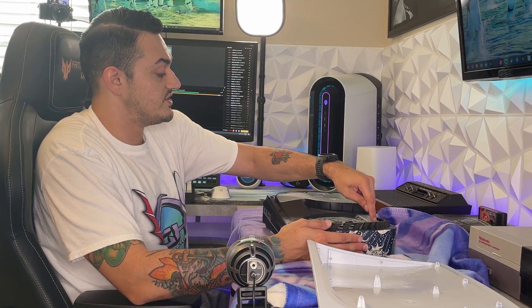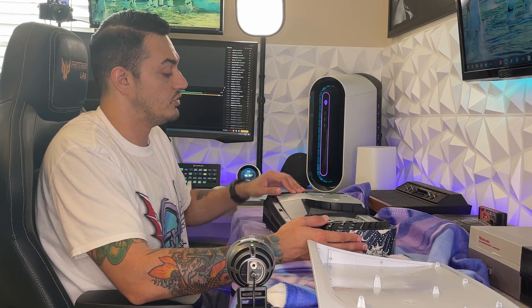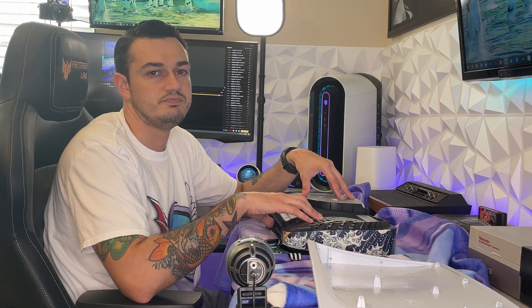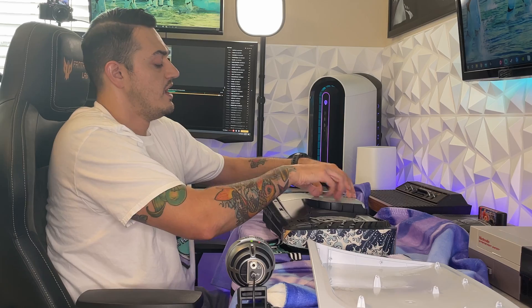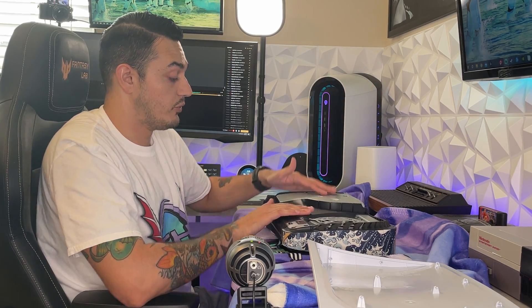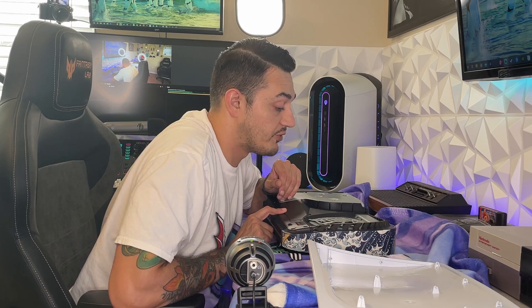This is the business end — you have your expandable slot for the NVMe SSD. If you get a stuck disc in the optical drive, there are four tiny Phillips heads that give you access to your disc drive. If you want to upgrade the built-in fan, there are four T8 screws in here to access it. We might do a full teardown of the PS5 in the near future, but for now what we need is a very tiny Phillips head screwdriver.